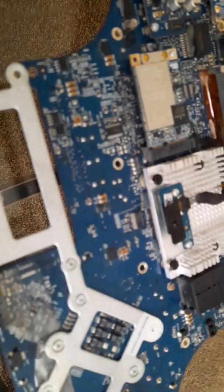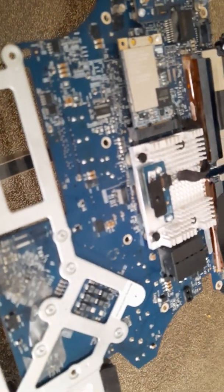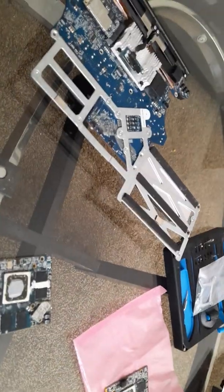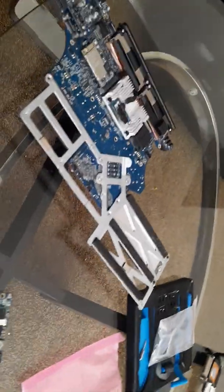How I discovered that is when you plug the computer in without all of the pieces on, there are four LEDs. The first two LEDs light up, the third one blinks and doesn't light up, and the fourth one remains dark.